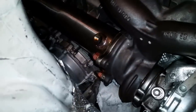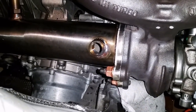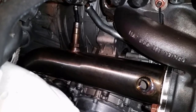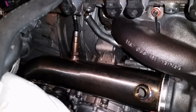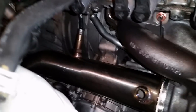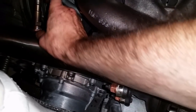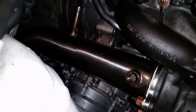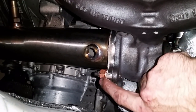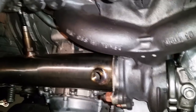Alright, so now I got the test pipe bolted up, and that's the eBay test pipe I got for like $68. I'll put the link in the description. And my 90 degree elbow did not work. I couldn't get it to line up so that the oxygen sensor would fit in there in the back, but there's plenty of room now, so I can get a different kind. I need a straight one instead of an angled one. Alright, so moving on. I think the last thing, and also I did not torque these, I just tightened them down real hard because torque wrench, forget about it.